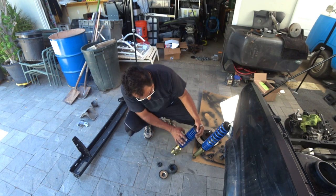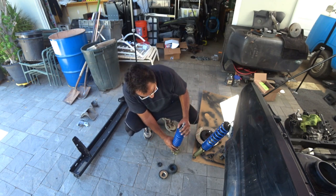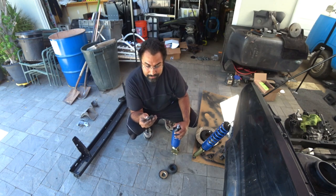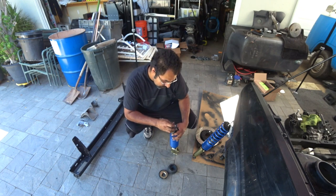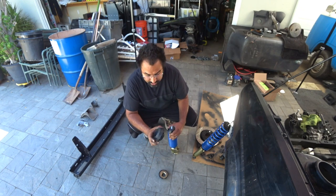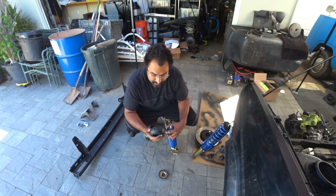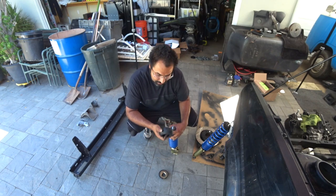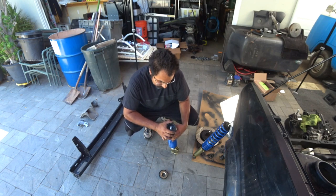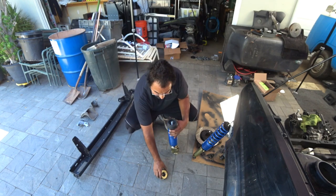Make sure your coilovers are as far down as possible so there's no tension on there. You're going to buy a brand new strut bearing, mount that on top, and then a new strut cap. Now these are the performance ones versus the stock ones that came with the metal plate on them — much better, much stiffer, they do a better job. So mount that on top and then use your strut cap.